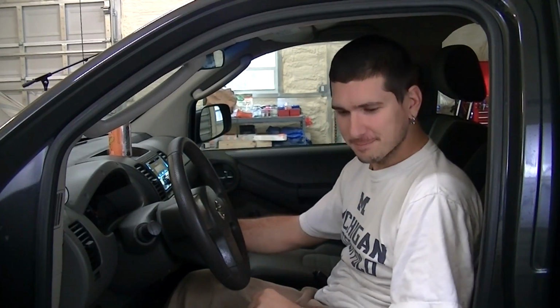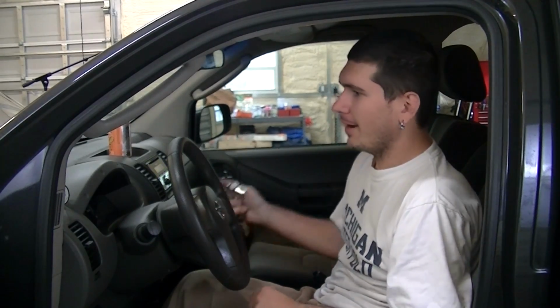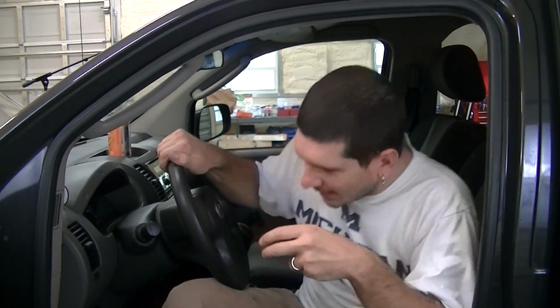Okay, let's hear the fruits of our labors. All right, purring like a kitten. Now, I didn't throw any codes, but if you do notice that your check engine light comes on, that's probably because you didn't put a vacuum hose on right, or just didn't put it back on at all.